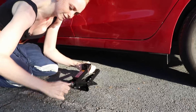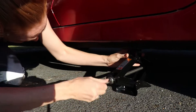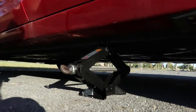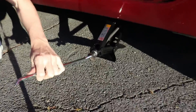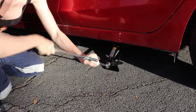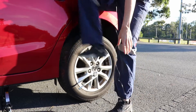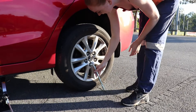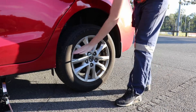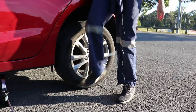Wind your jack up by hand — it's quicker by hand until it gets under the car, then we use the tool. See this gap here? I'm going to pop it just under the jacking point. Now for the tools — your hook goes in there, pop that in, there's always a gap. Then we go right to wind it up. While it's still on the ground, you want to crack your nuts — take them off in a star formation — using your foot, which you'll most likely have to do.